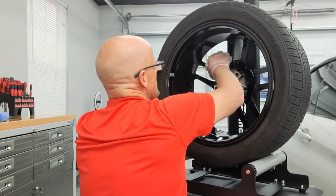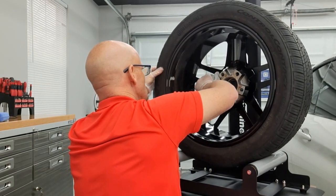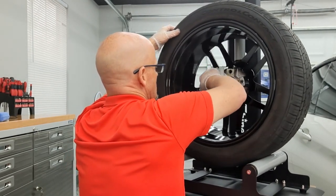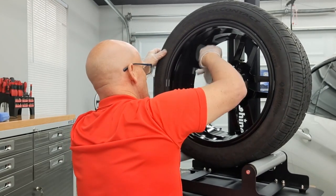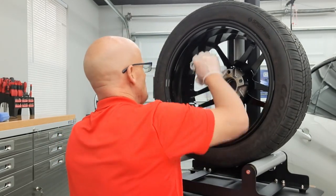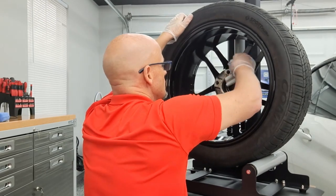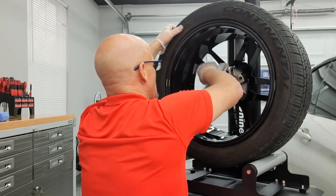As you're wiping, you can see rainbows pretty much when you start wiping this off. So you're wanting to make sure that you remove any of that coloration that would be there. Part of that is the flashing process. Chemical-based dry times are called flashing and curing. Water-based is evaporation. That's how it dries. Chemical-based dries from a process called gassing out. Starts with flashing, moves to curing, gases out to cure.